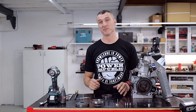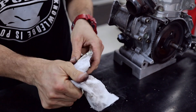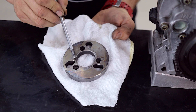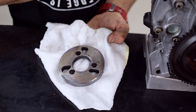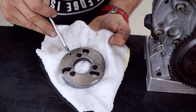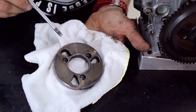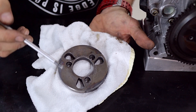The clutch shoes are just a piece of steel. The guys at Rotax, very clever — they have laser cut this and cut these little islands out of one piece of solid steel, then machined the holes to hold it. When the engine rotates, the centrifugal forces make the weight of this piece of steel fly out into the clutch drum, and that's what locks on and gives you the drive. Just the weight of this piece and the centrifugal force at 3000 RPM engages the clutch drum and gives you drive forwards. Where you want to inspect for damage is generally in the area of the three cut-out windows of the Rotax clutch shoes. If they're going to break anywhere, they snap through there.